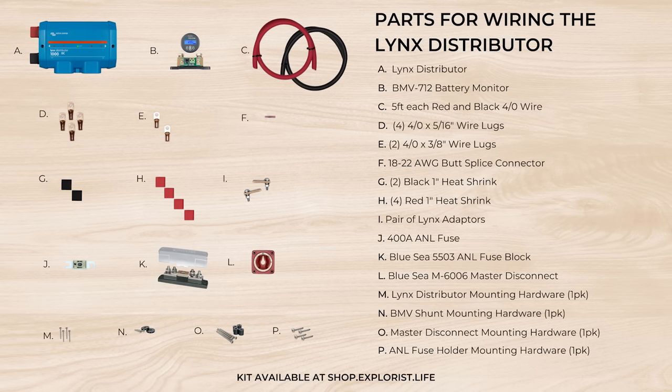Now for programming. Make sure the master switch is turned on and the Orion should show up in the Victron Connect app. Tap to select, put in the default password, and update the firmware as necessary. Once we're at the main screen, tap the cog to access the settings. Here is the cheat sheet we're using for programming the Orion specifically for these batteries. With the Orion programmed, we can put in our green remote jumper wire on the bottom of the Orion. Now we can see that our Orion is in the bulk charge phase, and we can see that power coming through on the BMV-712 as well. If we turn the solar isolator on, we can also see some solar power being added. We can leave solar, alternator, and shore power all on at the same time as they will all automatically regulate and synchronize as necessary. We also have a video where we installed dual Orions for faster charging in our Transit — we'll link to that in the description below.